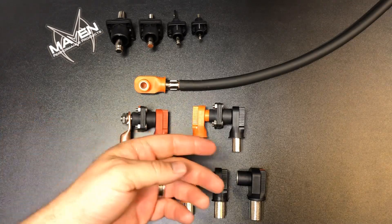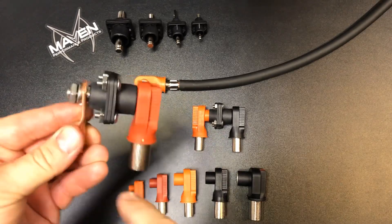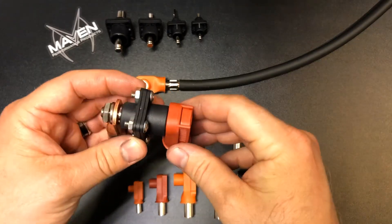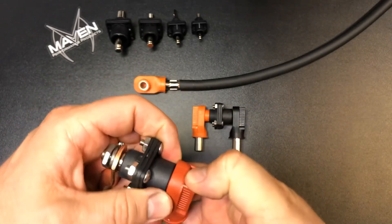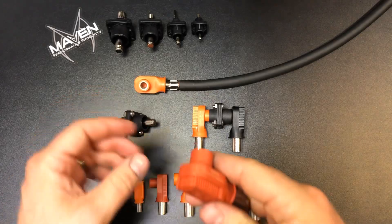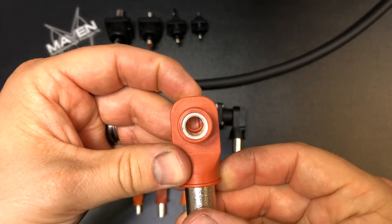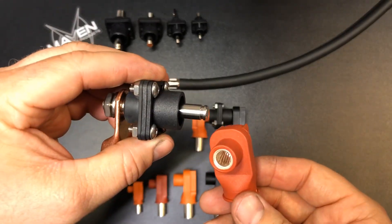We have the Type A and the Type B. Type A on one side has something you're fairly familiar with: a threaded stud with a crimp-type battery cable lug, and the quick release RadLock on the other side. The way they work is they have a quick release button — it comes apart when you push the button and pull it apart. On the inside, for lack of a better term, it looks kind of rifled, and then you have the button that you push, which releases it from the little groove machined into the stud.